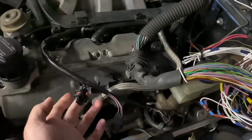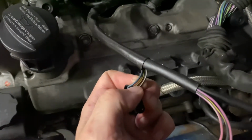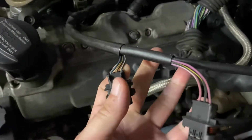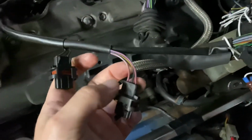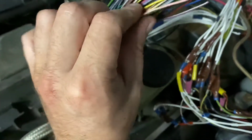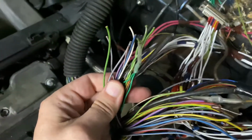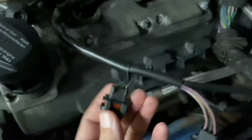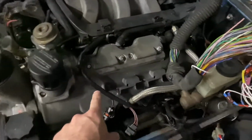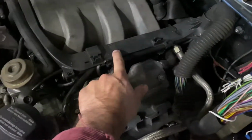So you have to have a high current ignition driver in the ECU, and then what it'll do is it'll send, it looks like that center wire, no, center wire. See how we have different colors? So if we look for pink and blue, up here we can see pink right here, and then blue's right there, but there's a lot of blue. So we'll take a voltmeter, check the blue with this blue right here, that pin, and we'll just find the wire that way. But then we know, okay, we have our 6 coil igniters, right? And then we have 6 of the injectors.